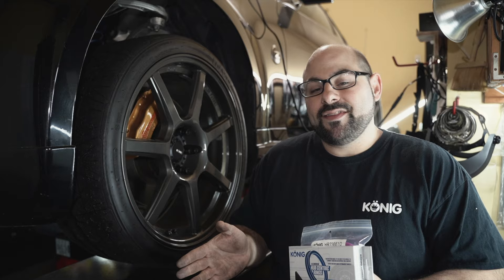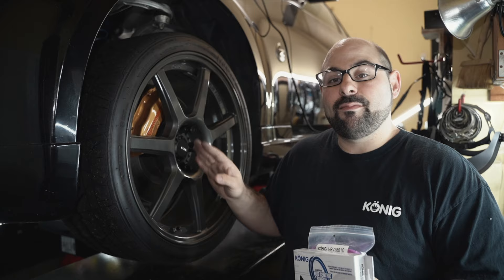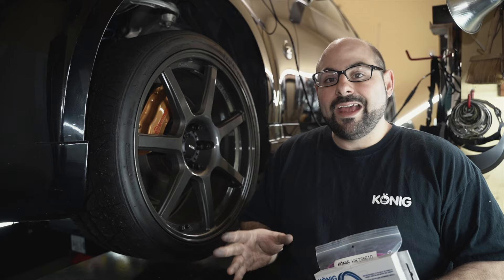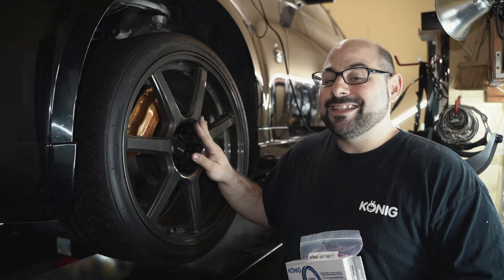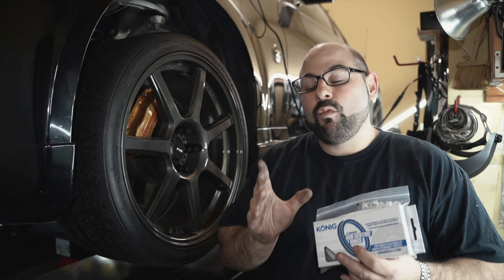Whether you choose aluminum or plastic hub rings, these are not safety items and they're not structural items. The hub ring's job is essentially a dowel pin — it's just there to make sure the wheel goes on and is perfectly hub-centric to the hub. Some people talk about how the weight of the wheel rests on the studs, and that's all true. However, once the wheel is tightened down, that is exactly how the wheel is going to stay. The hub ring is really just an alignment tool, a dowel pin, and once the wheel is fastened down with the fasteners, it doesn't do anything.